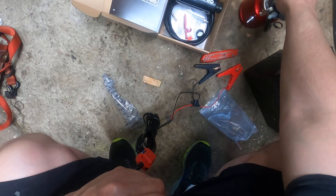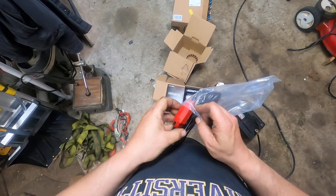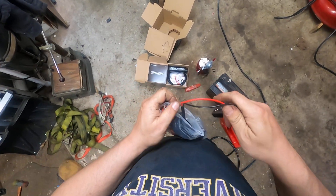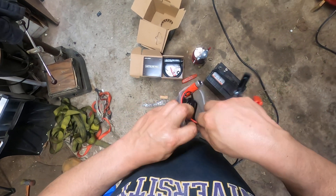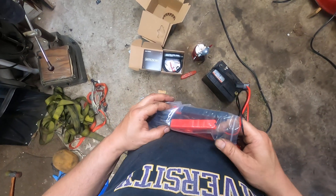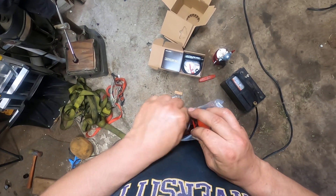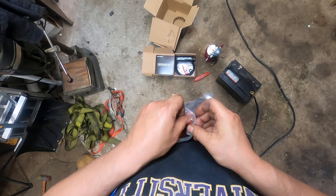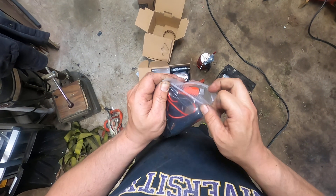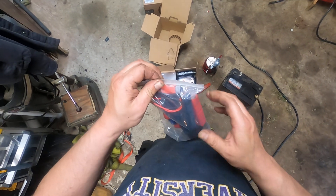The reason I bought this was the leak-down test is great for identifying that you have a leak, but sometimes it's hard to pinpoint where that leak is coming from by sound. So I bought this as a means to mitigate that. Some stuff is very obvious, but what I found out very recently with that twin cylinder Kawasaki is that although it seems very obvious and you should quit as soon as you see scarring inside a cylinder wall — you don't know.